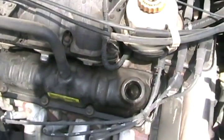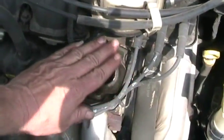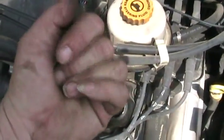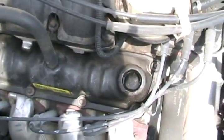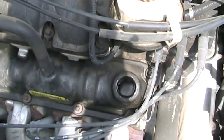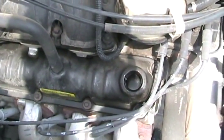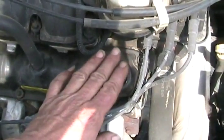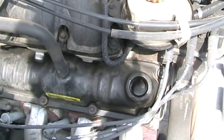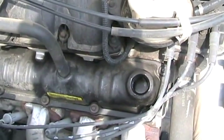If you have bad rings or broken rings and the engine's idling, there's a lot of smoke or a lot of air pressure blowing out of the PCV tube. If you have a constant stream of gases coming out of there, more so than normal, that means all your rings are bad or broken. But if it's coming out puff, puff, puff — rhythmically — that means you've got one broken ring in one cylinder, or one scored cylinder, or one damaged or cracked piston. So it gives you an idea that you maybe don't have to rebuild your whole engine.